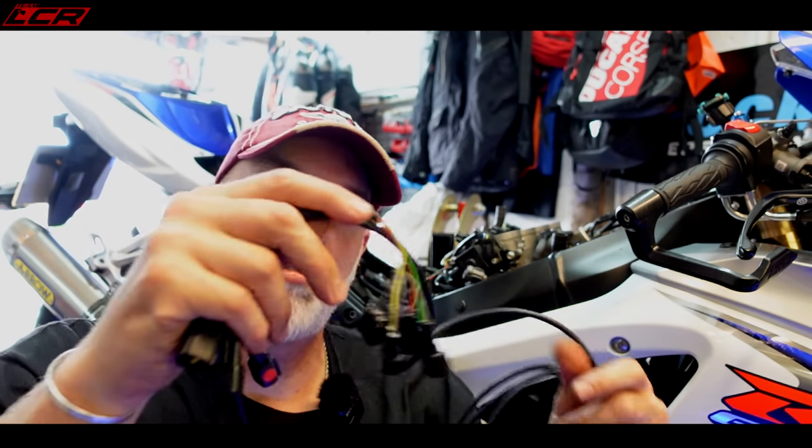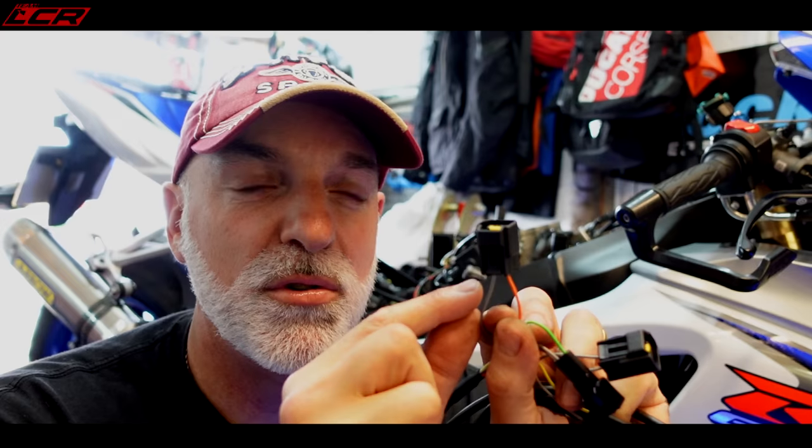So we've got two lots of connectors here. These basically piggyback onto those coil pack cables. I've got the instructions up. Just got to check the right colours because it depends on the model as to if the 12 volt feeds the right way round. So potentially you may have to pull some of the pins on these cables and reverse them. So it's a little bit complicated to make sure.